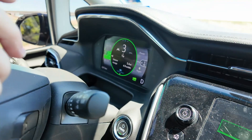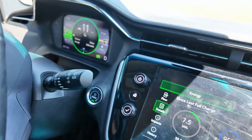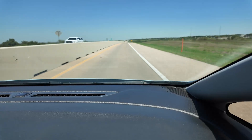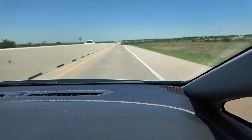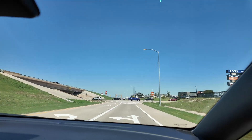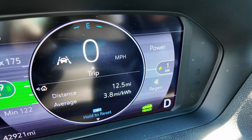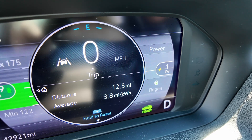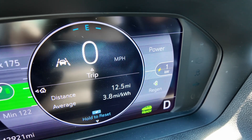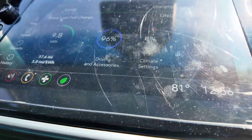At the end of the county road section on Run 2 — without one-pedal drive — they're at 4.9 mi/kWh, slightly higher than Run 1 at that same point. At the halfway point of 12.5 miles, efficiency is 3.8 mi/kWh and total energy used since last charge is 9.8 kWh. Temperature is 81°F.